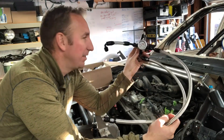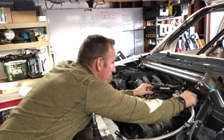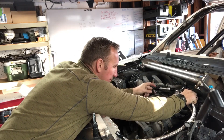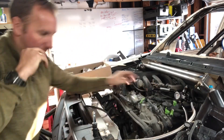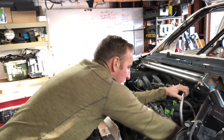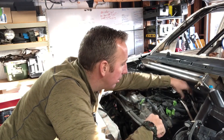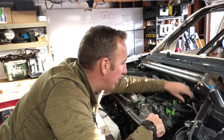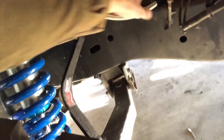So what we have is this — that goes to the fuel rail. This is a return line, this is an inlet line, and it's gonna go right here. I'm just soft-mounting this right now because I'm gonna pull it all apart again. When I get this squared away, these lines are gonna go down along the cage and I may need to move things around a little bit.